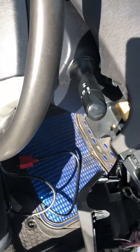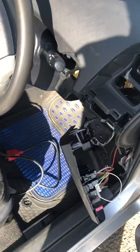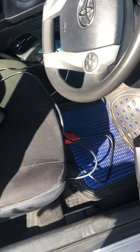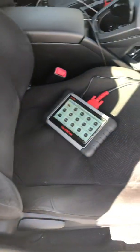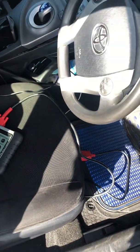And I don't have to change the steering power supply controller. So this is very important — I just wanted to share this with you guys. If you are doing anything to do with calibration, whether it be steering angle, ABS, or anything else, please make sure that you add extra power to your battery.